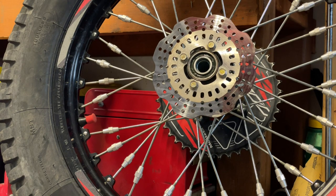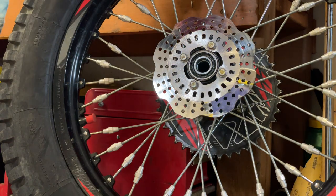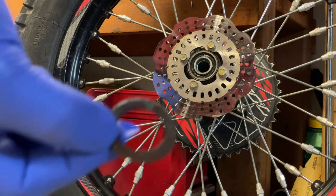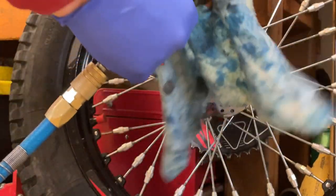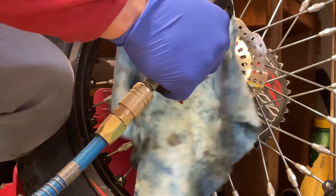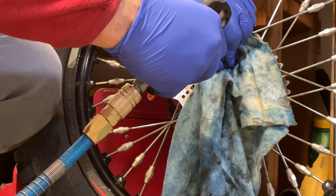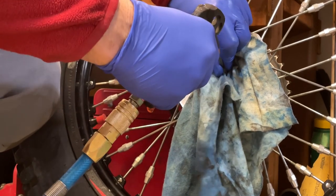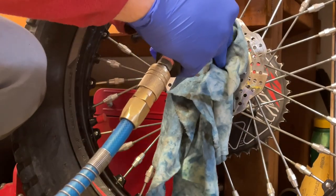So a little bit before I actually put this wheel together, I want to clean my bearing and then pack the fresh grease. So I took off the dust seal, cleaned it obviously. I use a small pick, or you can use a tiny screwdriver. The way I like to do it, I just basically put the stuff like this. Cover, it's going to be grease everywhere, but at least this will help me to clean the grease. And then I just go around.